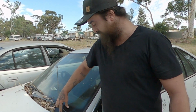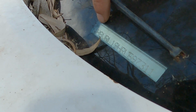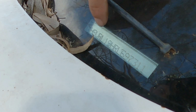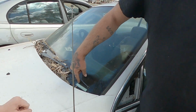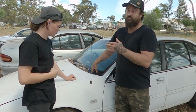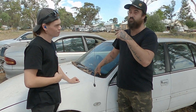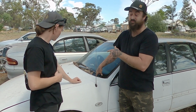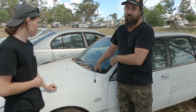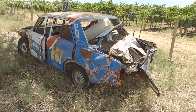With VRs, you've got 6H8 VR. So the 6 is the cylinders. The H8 is, I'm pretty sure, the period it was built or where it was built. And then you've got VR written there. So on the party car, it'll say VS. Yeah, right. And the only difference between your VS, because it's Series 2, Series 3, is it has Ecotech. Yep. Whereas Series 1 VS has the Buick motor. There you go. So it's pretty much a VR. Sick.